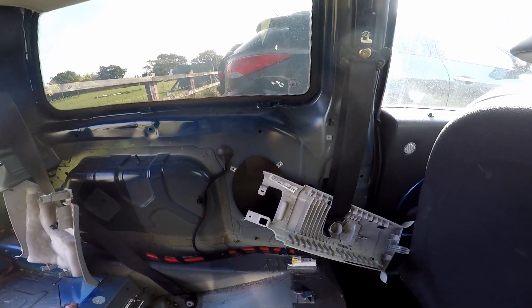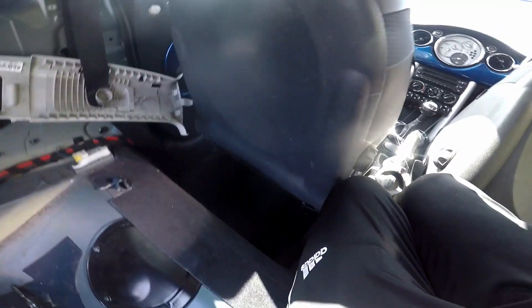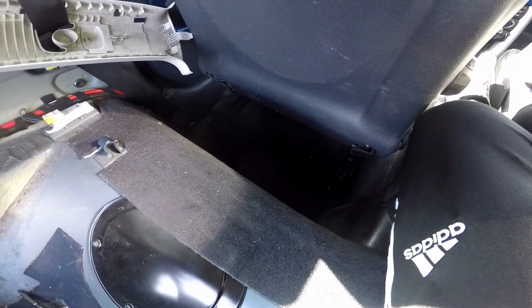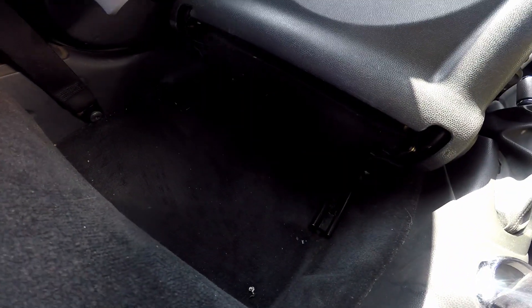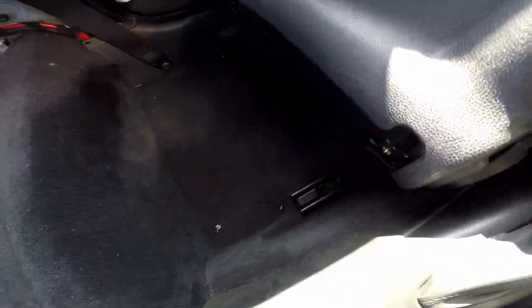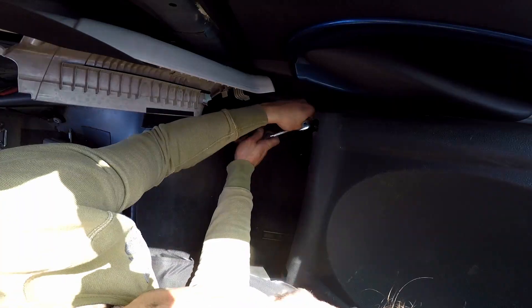The back is pretty much stripped, just really finding it coming off. But I need to get to the front first and I've still got no battery to open the passenger door, so I'm going to start to take the passenger seat off. I'm going to probably start at the bottom rails - I don't know if that's the right place to start. Going to try and get the chair out in one. Let's see if it works but I'm going to take these two Torx bits out and do the same at the front.